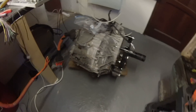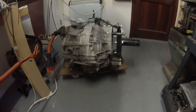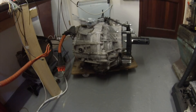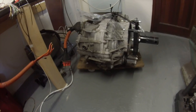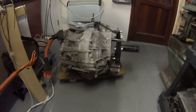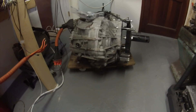I don't want to run it too much because chances are there's no oil in this gearbox at the minute, and I don't want to put oil into it because the next part of the plan is going to involve taking this apart. What I want to do is weld up the planet carrier in the power split device so that we can use both MG1 and MG2 for propelling the vehicle, since this is not going to be used with an internal combustion engine again.